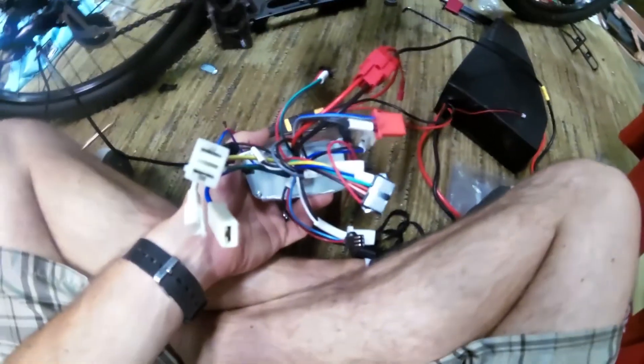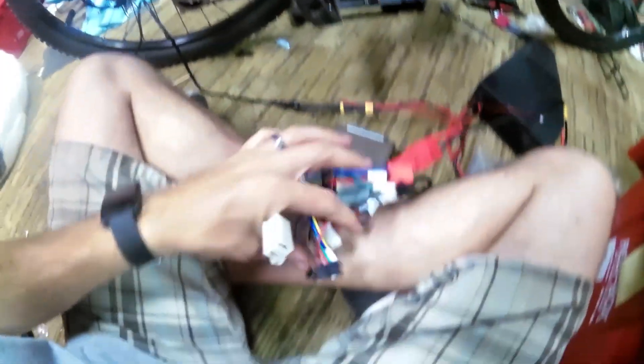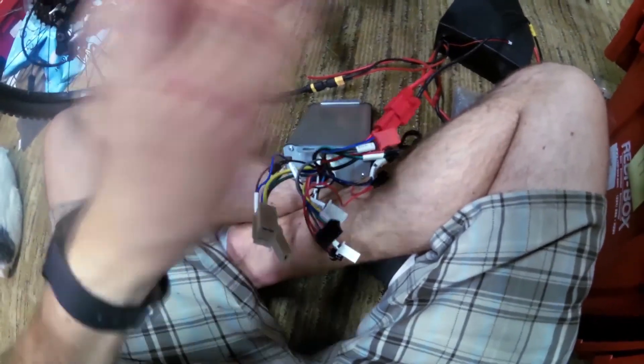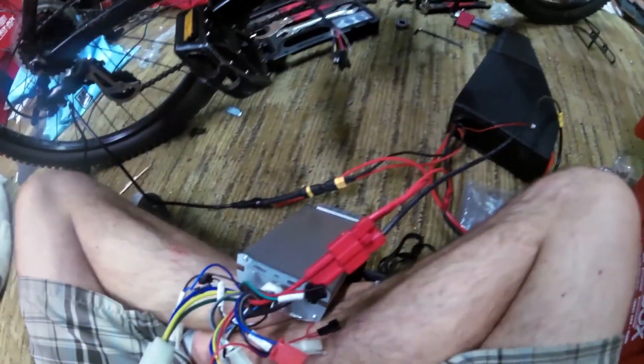When you get the Cyclone, it's a little intimidating because it looks like this, and you're like, oh crap, which one's the red wire, I've got to defuse this bomb, I'm never going to do this, we're all going to die. But the good thing is, this is from the Cyclone motor, so there's just three pins, three plugs, and there's only three plugs that correspond with those — you find the three, plug them in there. This is from the throttle, and there's only two plugs, and you find the two plugs that go in there. And then this is the power to the battery, and there's only one that goes to that, so everything is actually really simple. When you get it, don't freak out — it's actually pretty easy.